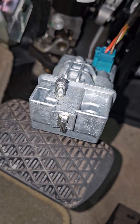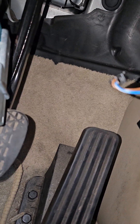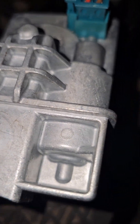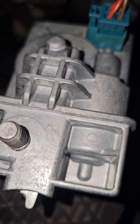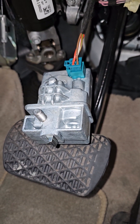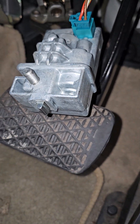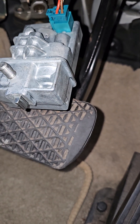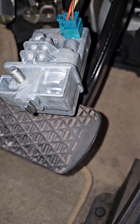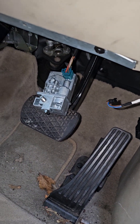So that's all I've got to tell you really. I'm going to replace the motor which sits in there, and hopefully the follow-up video will show you what the noise should sound like. It's quite anemic compared to what it used to be. It's quite a simple job which anybody with a bit of confidence and the right tools can do themselves. You need a 13mm spanner, a T12, an E12 for the underside column bolts, a 10mm socket for the battery terminal, a T20 for the screws underneath the parcel shelf, and a Phillips screwdriver. Anyway, I'll love you and leave you — bye now.